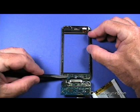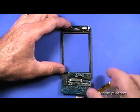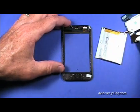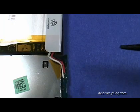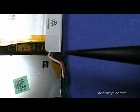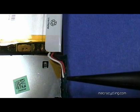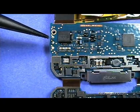Having loosened the adhesive with the flathead screwdriver, use the black stick to lift the board from the case. The lower board and battery can now be removed from the front cover. Notice the white, red, and black battery wires on the piece just removed and their solder points on the board. The solder points can also be seen on the opposite side of the board as shown here.